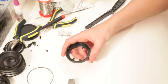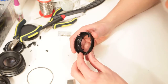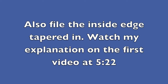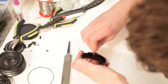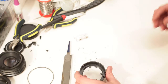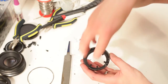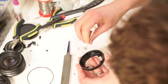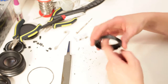I went around the ring and chopped it down — only took a couple minutes. Now I'm gonna file this flat; I do it over the garbage can. I'll file it flat and scrape this out, get rid of some of these tags. There's a little bit of oil residue in here from where the helicoid would slide up and down, so I'm gonna take a dirty old Q-tip and get rid of this grease. I think I'm gonna chop all these tabs out — I don't think we need them for anything.